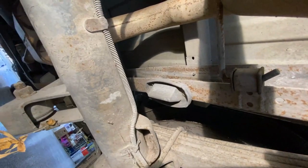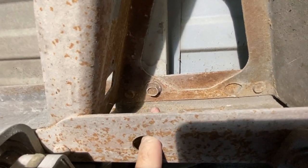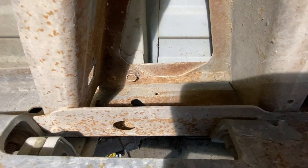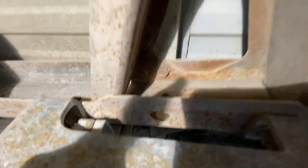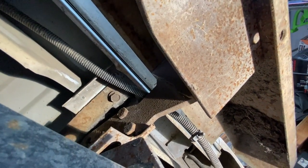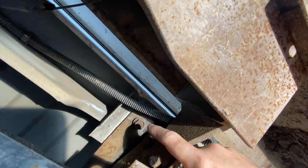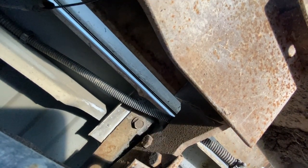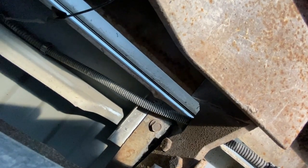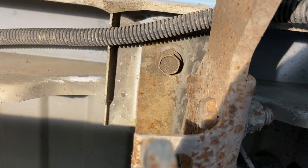For orientation, we're now on the passenger side, just past the axle. There's the third bolt right here, and here is the hole to access it. This is a class three trailer hitch — if yours doesn't have a hitch, it's even easier to get to. There's the fourth bolt at the very tail end of the frame, at the bumper bracket. Depending on what you've got, you may have to drop a hitch, drop a bumper, or maybe not.